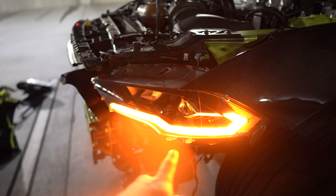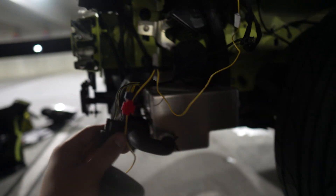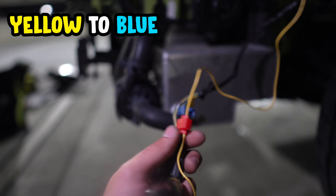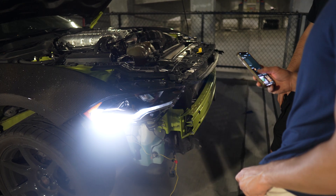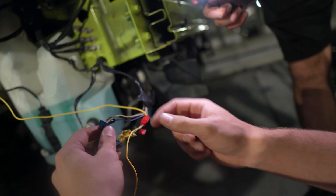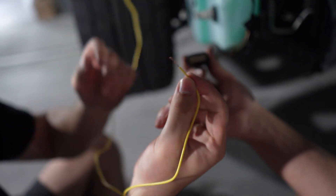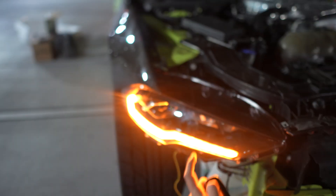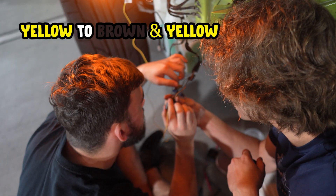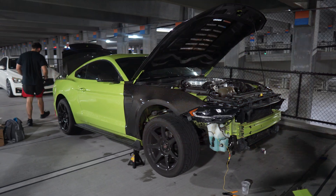The turn signals - I didn't know they actually worked like this. I thought it was just the corner, but it goes all orange which is way better than the OEM setup. You're going to take your yellow wire and go to your fog light plug-in on the back side of the harness, then take the yellow wire and tap the blue wire with a t-tap. We're t-tapping into the other side - it wasn't the right one. The color you need to tap this yellow wire to is yellow and brown - not the blue one. We stripped the wire back a little to figure out which wire it was on the OEM harness, and that's the turn signal one. It seems like it's brown and yellow - it's the second one in, right before the blue wire.